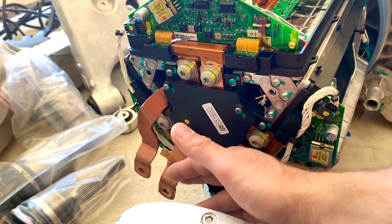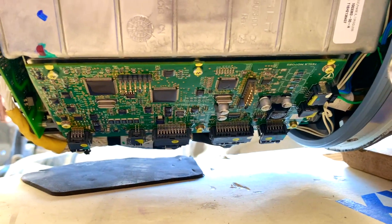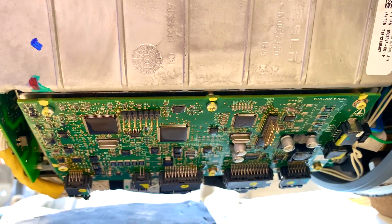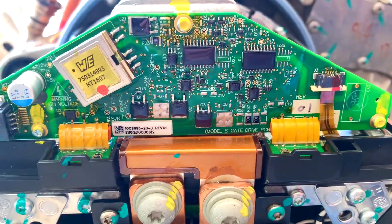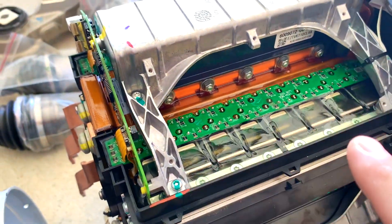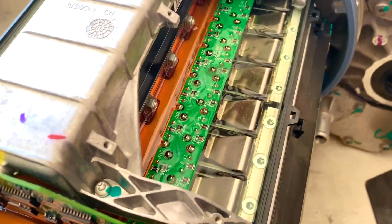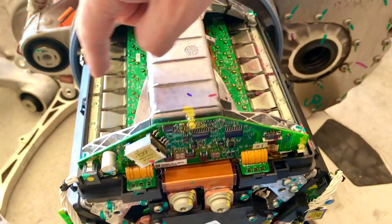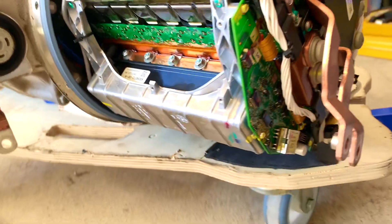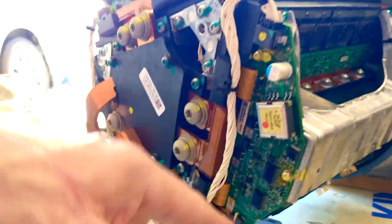This is where you get the 400V, 350V nominal, attached to the motor, and you need electronic commands to get this thing going. Here's the logic board — this is the computer where all the logic connections are made. From here it fires commands to the gate drive boards, which then drive the power MOSFETs — or IGBTs, whatever you want to call them. For each phase you're going to have two of them. This is a three-phase motor, so there's a power section for each of the three phases.